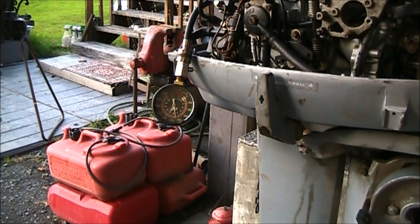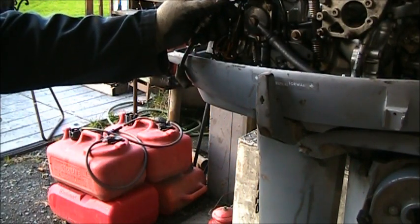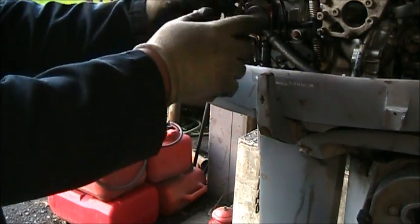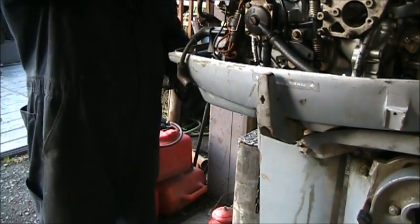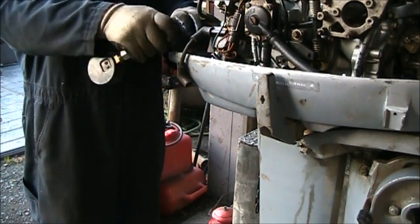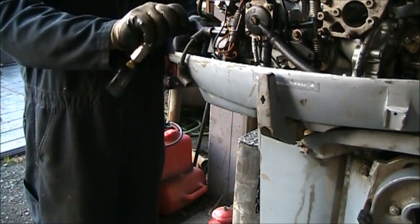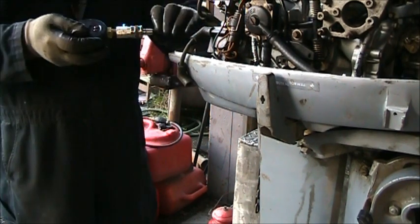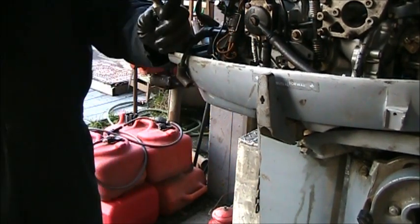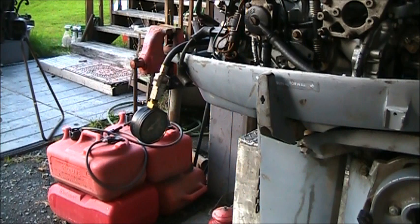Looked like it had a lot of oomph. Oh yeah. We got 130. 120, 25, 30. We got 130. I'm going to do that bottom one again. That's a bit of an issue right there. What we'll do, if that's at 100 again, I'll probably spray some Tri-Flow in there. We are zero. Let's give this bottom one another ride on the pony.